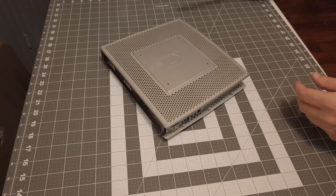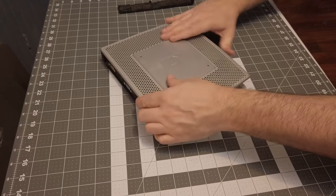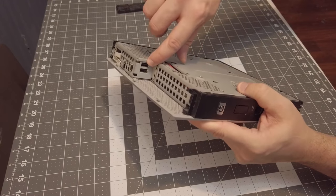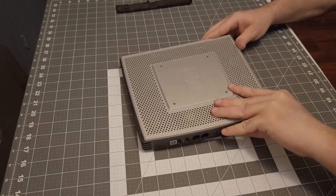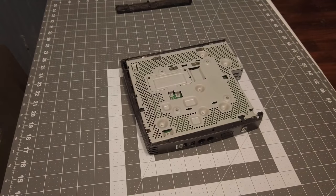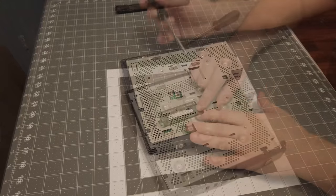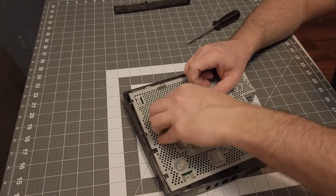It's also worth noting that we'll find two more USB 2.0 slots hidden inside the unit. This comes in handy if you want to tuck away a USB flash drive inside the unit. On the back of the unit, we've got an extra RAM slot. I had a 4GB stick sitting around in my parts pile, so I've already gone ahead and upgraded this unit to 4GB. It's important to keep in mind that because this is a 32-bit processor, we can't upgrade past 4GB.